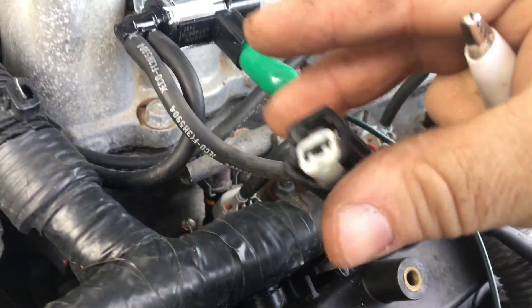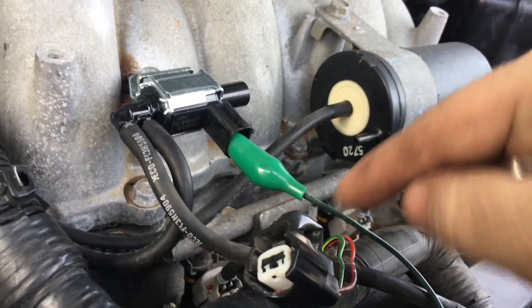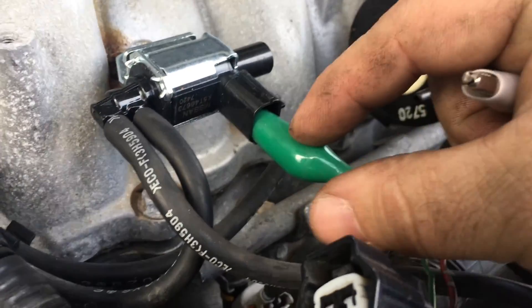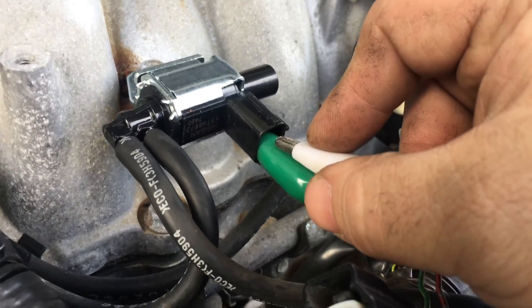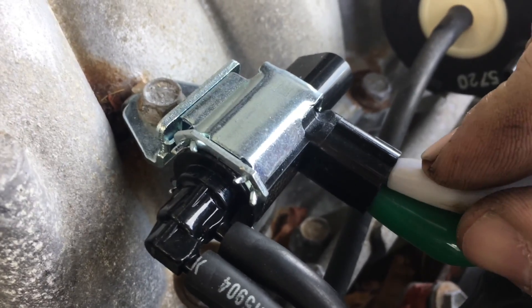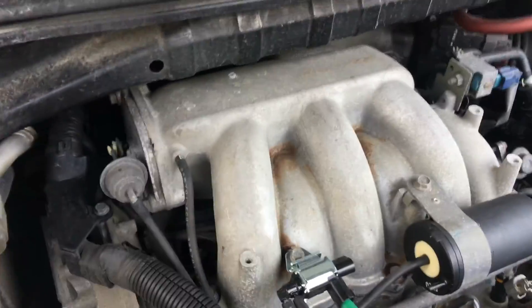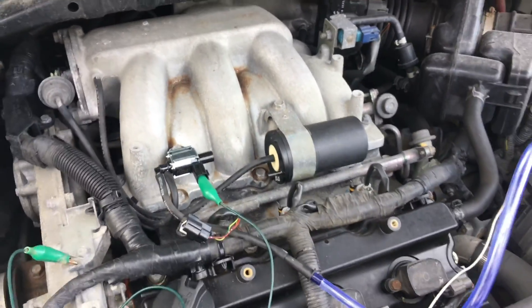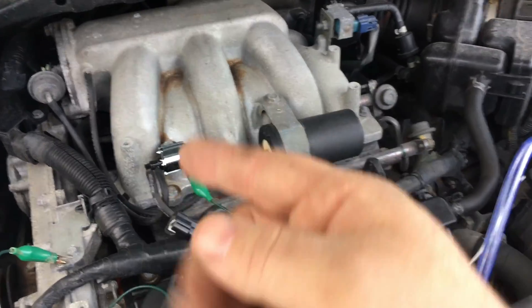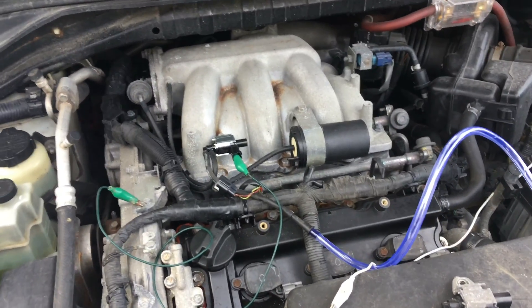Important note: I have unplugged this connector. You do not want to feed battery voltage back into the ECM harness — we're only testing the solenoid itself. We don't want to apply voltage back through the harness into the ECM; that's going to be very bad. I already have the negative on the lower pin with rubber shielding it from the upper pin. I'll slide this into the top, make contact with that upper pin, and watch the actuator actually move — you can actually hear it click. If that actuator is clicking and passing vacuum to the actuator arm, then the solenoid is working the way it's supposed to. Mine is new because the old one was not working properly. This is a P1800 code fix on the 2006 Nissan Murano. Hopefully somebody finds this helpful. Thanks for watching.